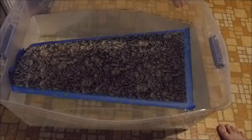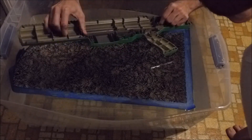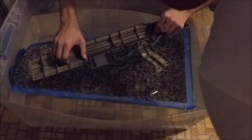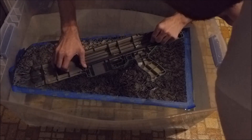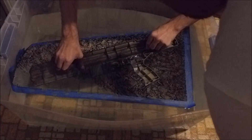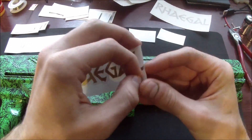The activator is on so that ink has become liquid on the top of the surface. Now we can line up our shell exactly where we want it, trying to find good pictures on the shell so we really get the images we want in the places we want. Once we're there, we just push gently through and the film will break as soon as the piece breaks the surface of the water. Hydrographics is just a really cool technique. The trick is to take your time, tape everything off, and really just not rush the process. Practice will of course make perfect. Nobody is good at this when they first start out, but this shell turned out perfect.